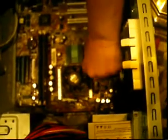And the power supply coming from the motherboard is right here. We're going to go ahead and detach it, and you just pull up gentle, and you know it's the power supply because it's got 3 little pins right there. Next, here is a fan right over a heat sink, which at the very bottom, which you can't even see it, is the processor socket.